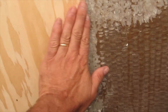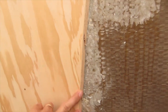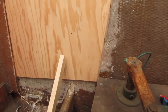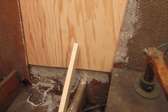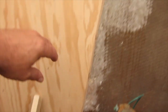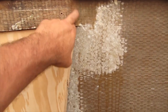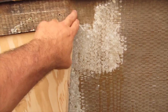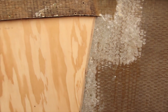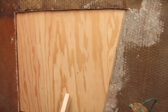Because of the fiberglass, I want to come in here a little nicer. So I think I might cut this down a little more with either my sander, or I did bring my electric planer today. It probably would work. That's what the factory had theirs cut up on this piece. But the fiberglass really doesn't touch right here. There's a gap. So they probably should have done a little more angle. So I think I'm going to do that next and then refit it.